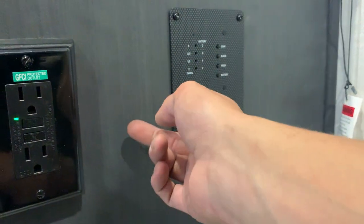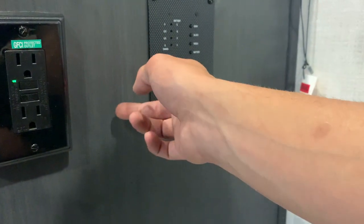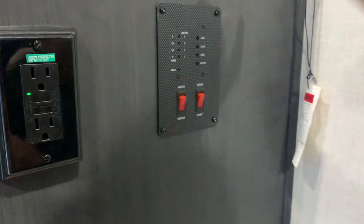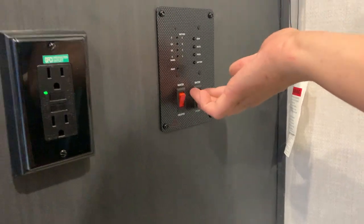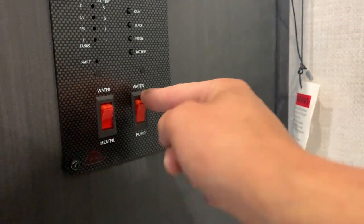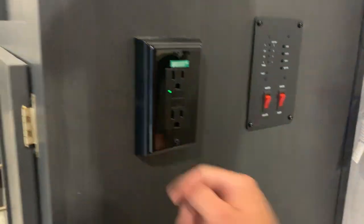You've got your water heater switch. If you turn that on while running it on gas, the fault light will come on and the water heater will try lighting itself three times. If on the third try it doesn't light, the fault light stays on — at that point just turn the switch off, go hit the reset button at the service port, and try turning it back on. With the propane system, air does have to be purged out, so it can take a few tries. Then you've got your water pump switch — turn that on and it draws from the fresh tank. Your main GFI plug is here with a test button on the bottom and reset on top. If you ever have an outlet that doesn't work, this is the first place to check — just make sure it's not tripped.